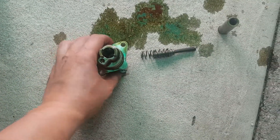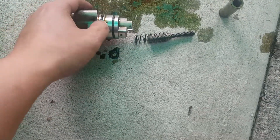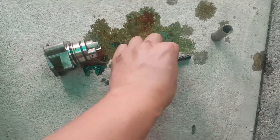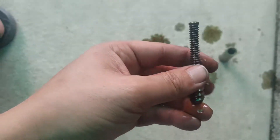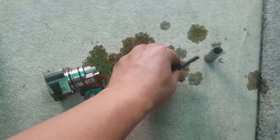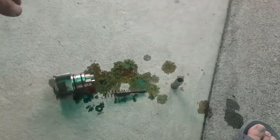Here's the timing chain tensioner — I opened everything up. I'll be changing the rubber seal, which is completely flat, so I won't be reusing it. I'll also change the main seal I showed the part number for at the beginning of the video. I took the pins out and they look in really good condition — still have a lot of friction on the thread, so it's fine. But I'll sand it down a little bit anyway — it feels almost brand new. I also ordered an L-shaped pin that you stick in to hold the tensioner compressed while you install it.